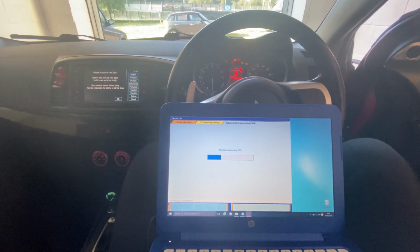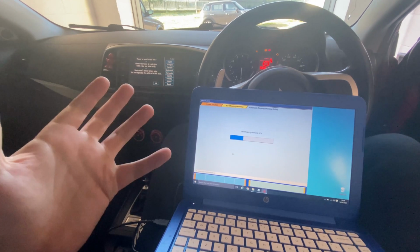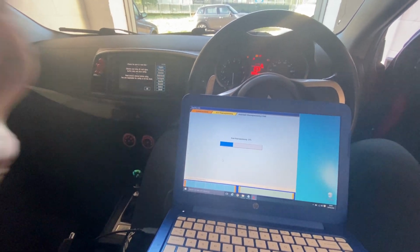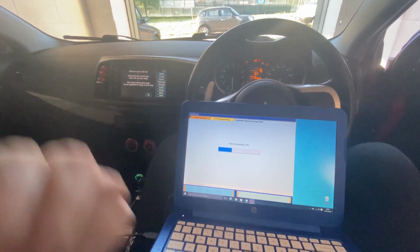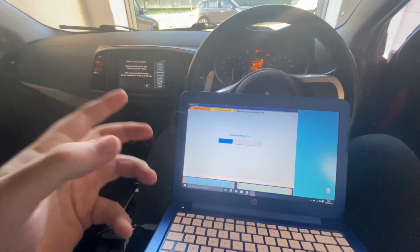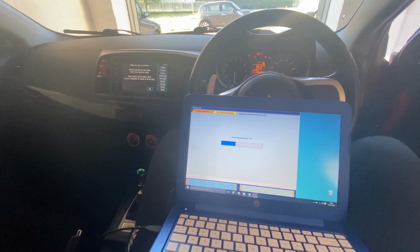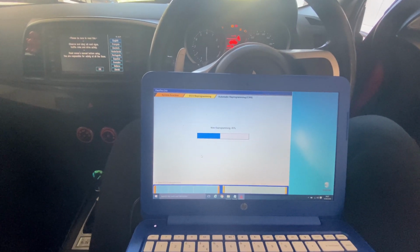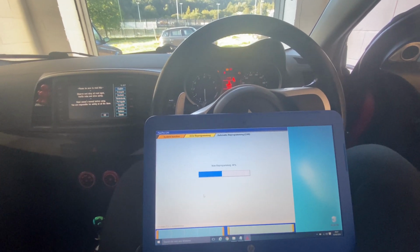So really important, take your SST to someone who has experience with them. Generic garages, while they're probably more than capable of working on the majority of cars, this SST gearbox is specialist, and you do need someone who knows the gearbox. Anyway, the firmware is almost done. Then we just have to do a gearbox reteach, and it'll be ready for Chris to take home.